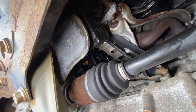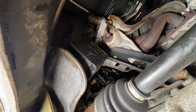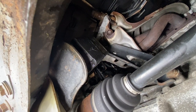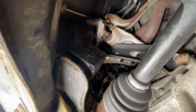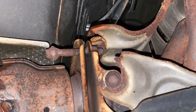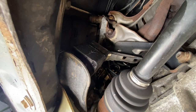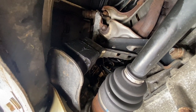I went all the way around that flange — I'd rather put too much than not enough and still hear the leak. This cures in one hour but I'm going to let it sit longer because I put way more than needed — I used pretty much that whole tube. This is what it looks like underneath; I just shoved it all in between the flange. Like I said, this probably isn't the best way to fix this leak, but it's a very cheap, easy way without having to remove the exhaust manifold from the head. I'll see you guys in about an hour or two.